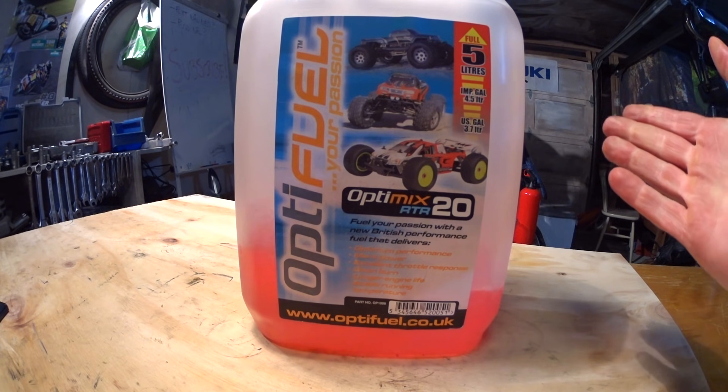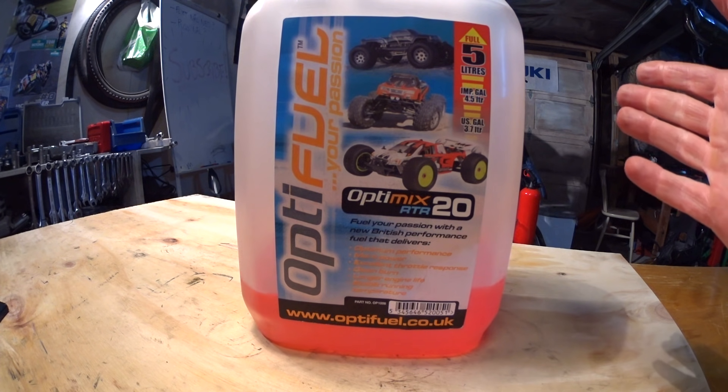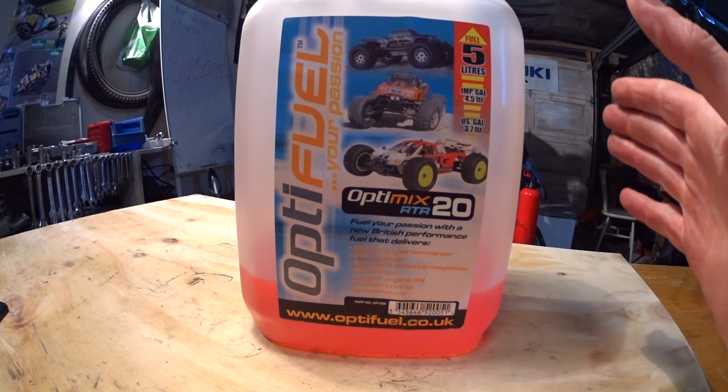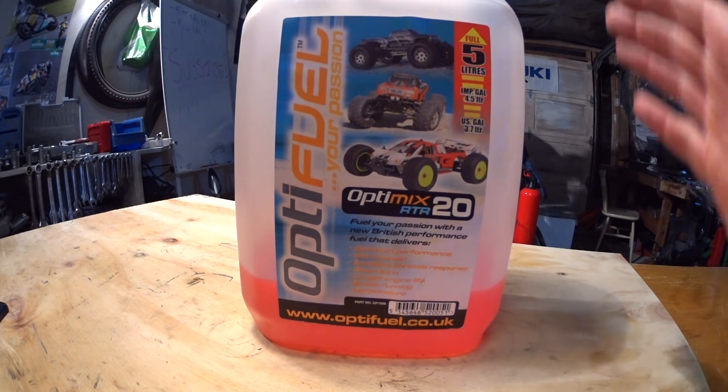Run RC fuel — methanol and nitromethane. Seriously, this works, and it's not as bad as people make it out to be. Go watch my videos on the moped on methanol and nitromethane and see for yourself. Get ready to upjet a lot, make sure your fuel system is up to it, and be prepared for insane fuel consumption — and by all means go rich.